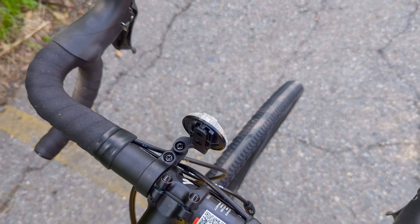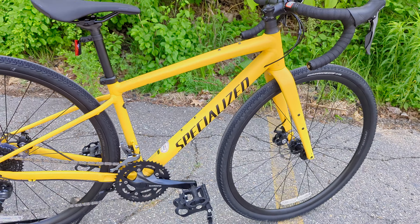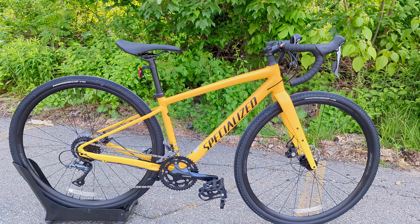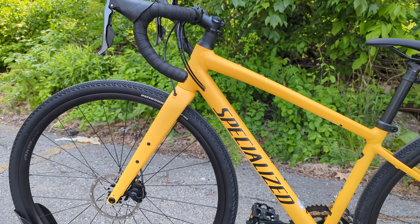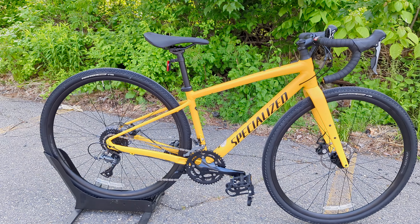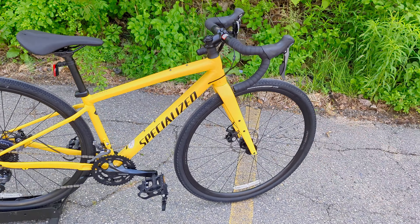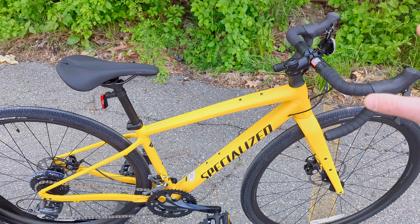Braking is a mechanical setup clamping down with a one-piston Tektro Mira flat mount caliper. The handlebar is a compact alloy handlebar, and you'll notice a nice short stem. That's because the E5 variant runs a shorter reach and slacker head tube angle than prior generations. In a size 54 it would be 71.25 degrees with a reach of 383mm and a stack of 578mm — the front end is nice and tall, with these stubby stems keeping the overall cockpit size the same.